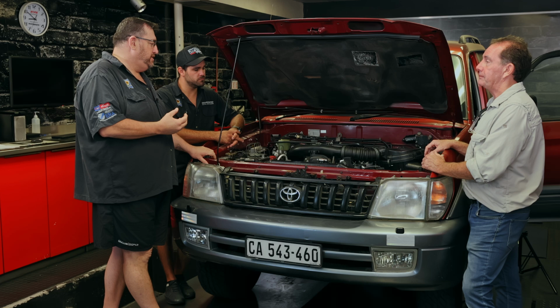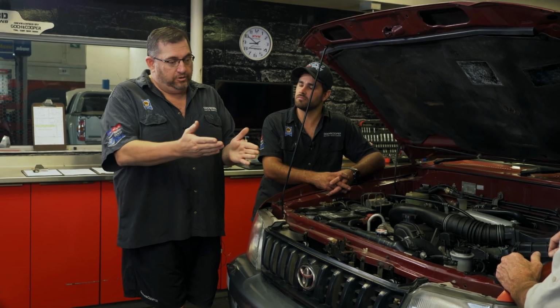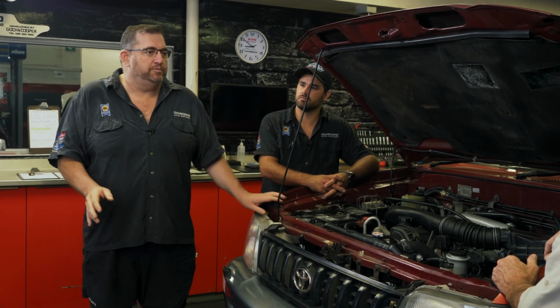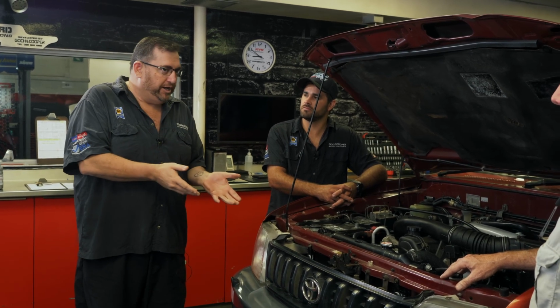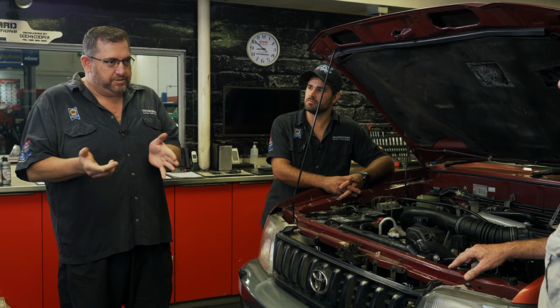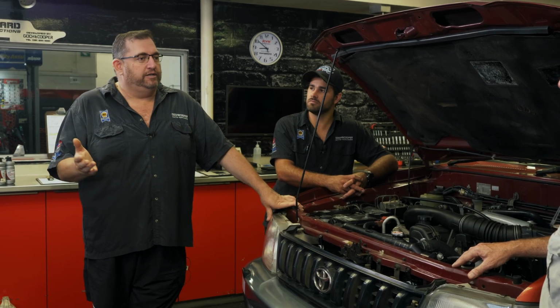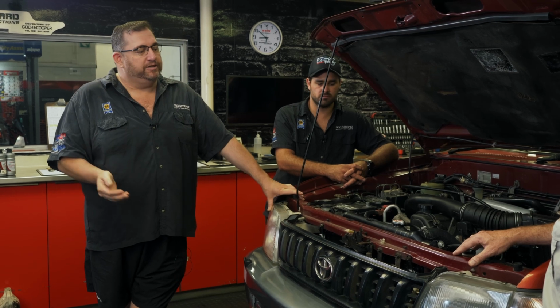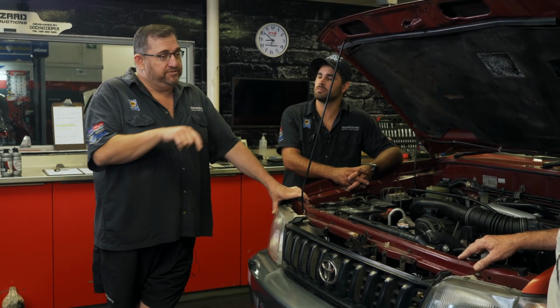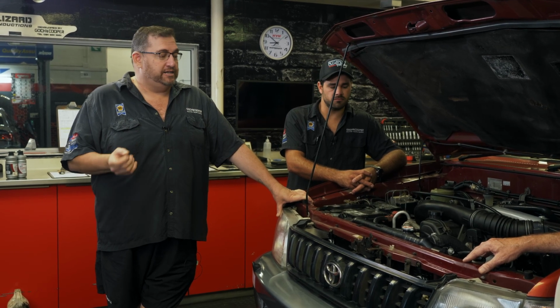Now, very important is to educate the consumer to use their senses, because like you just mentioned, it's critical. If you park somewhere at a shopping mall, before you get to the parking, have a look if the base is clean. When you reverse out, if you see water, it's probably just your aircon, but if you see a different color, stop, smell it, and go and speak to somebody about it. You don't want to be riding on the road and then you've got no water in the vehicle. Things happen, pipes burst, water pumps fail. And the problem with most of today's vehicles is when there's no water in the system, your heat gauge doesn't work. And that's a critical thing.